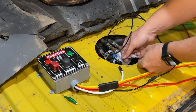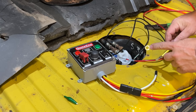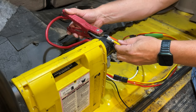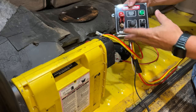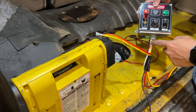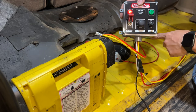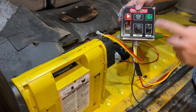Now I can plug that into the wire that my ignition switch controls and connect this connector to a battery source. For this quick test, the battery source will be a jump pack. Now if I flip up the ignition switch, it should turn the fuel pump on. I can hear it running — I don't hear it leaking on the ground this time. I can hear it pumping back to the tank now. I think we're ready to see if it'll start.